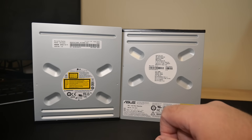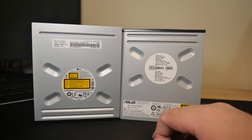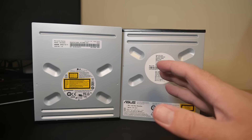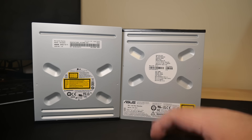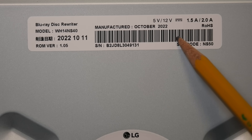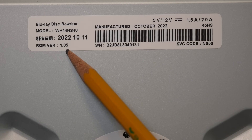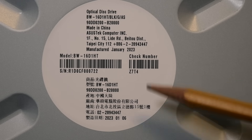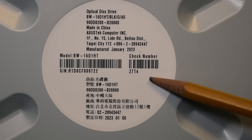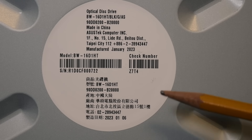If you're just getting into this you'll probably find a whole bunch of outdated information about certain revision levels of these drives and only certain ones being good for this. That information is probably still all true, but I haven't gotten a drive in the last year that didn't have all the appropriate abilities to be flashed. My LG drive was built in October 2022 — revision 105. My Asus was built in January 2023, and I just got it about a week ago, so the newest drives I'm buying are six to eight months old and they've been fine.